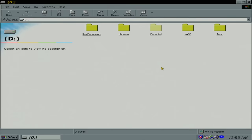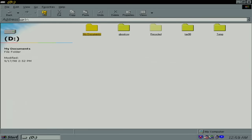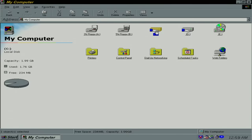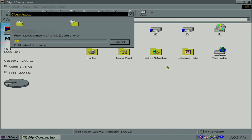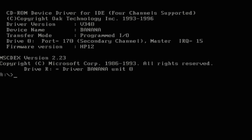I really want to hear that D drive work — it seems like it sounds lovely. So let's try copying these documents over to C drive. Both drives are getting wiped anyway. Well, C drive is about full too — 234 megabytes left. Oh yeah, that thing sounds crunchy. It is running awfully slow for a SCSI drive. These documents can't possibly be that big. Let's cancel that. Let's try to run some benchmarks on these drives — who would I be if I didn't try to run SpeedSys on SCSI drives? We are performing like a regular old Pentium 133, with that motherboard's fake cache being painfully obvious.